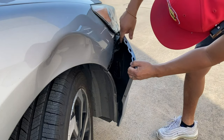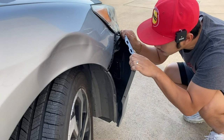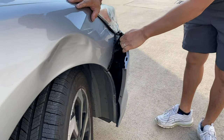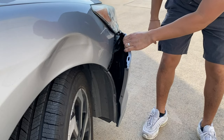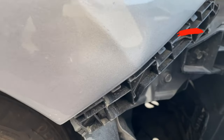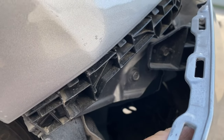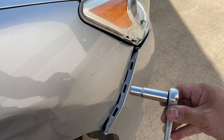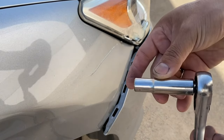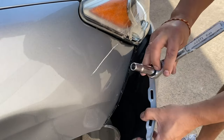And then right here, you're going to reveal another screw. So it's going to be two bolts — one right here and one right here — and they're both 10 millimeters. So right here, these two, one and two right there. I'm going to take those bolts off. There's just going to be a ratchet set right here with a 10 millimeter. Just like that guys. All right, so pull this back.